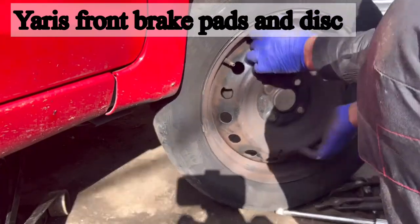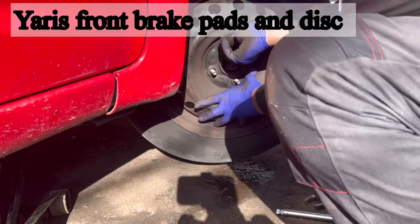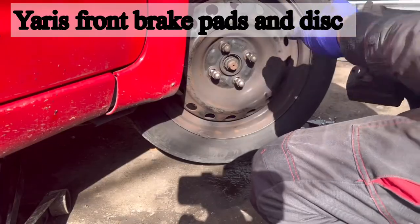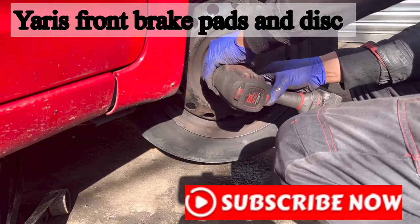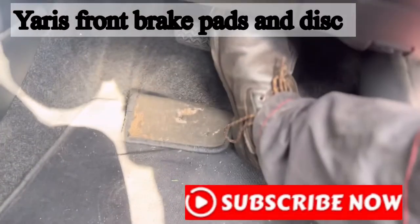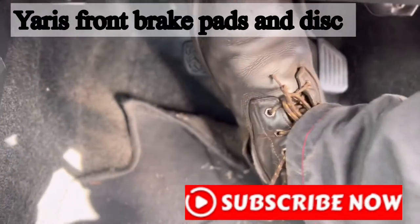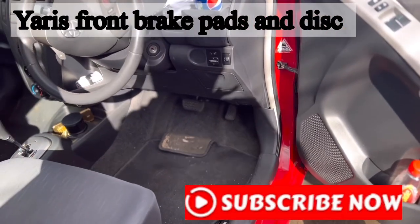It's clean now — I am going to put the tire on. First couple of threads I am going to do by hand, after that I am going to use the gun, because sometimes using the gun can cause cross-threading. This is a very important thing — don't forget: after you do the brake, make sure you press the brake pedal four or five times until it gets hard. Otherwise when you take the car on the road, the brakes will not hold sufficiently. Thanks for watching — I'm Charlie from Sanu Motors.